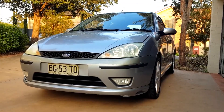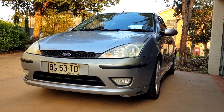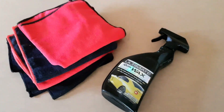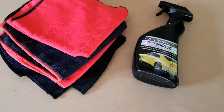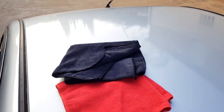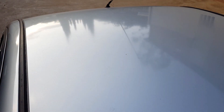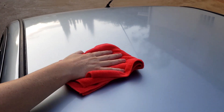Let's move on to the last step. If you remember, what you want to do is have a really good quality quick detailing product, such as this quick wax. It's this final coating that will be exposed to the elements before you wash your car again, so you want it to be good quality. You'll be using two microfiber towels here — make sure you swap them often if they get dirty. Use the first to apply the spray and rub it in, and then use the second to give the car a final once-over. The reason you're using two towels is that the first one gets quite wet from the spray and may not allow you to completely dry the car and polish it to its final level of shine. So you'll want a second towel that's clean and dry.